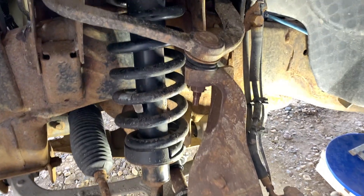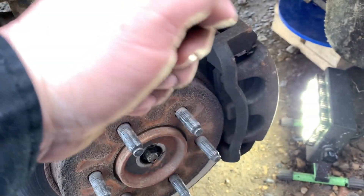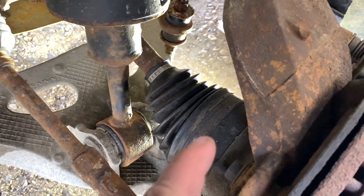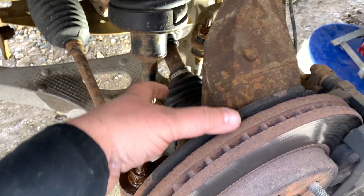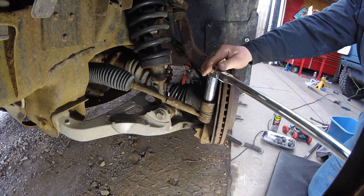So to remove the IWE I'm actually doing a bunch of other things, so don't exactly follow what you see in the video. You need to bust the upper control arm free from the spindle, remove your vacuum line from the hub, pop off the steering tie rod for easier access. I'm going to be removing the brake caliper — you don't necessarily need to do that. You do need to remove that little nut from the front, 13 mil, because it holds your axle in place. Then before you're ready to slide the axle out, you need to remove the bolts from the IWE and pull that out with the axle to prevent any damage to the seals.